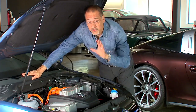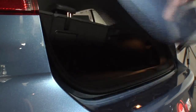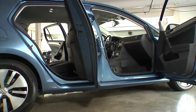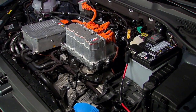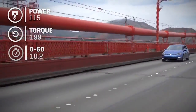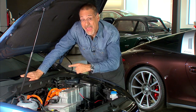Under the hood of our E-Golf is strictly an electric motor — not a range extender, not a hybrid, not a plug-in — a straight EV with no transmission, just a single-speed reduction gear. The battery story is central: a 24 kilowatt-hour lithium-ion pack using the latest technology. It doesn't intrude in the back or create a big lump in the cargo bay. The battery largely lives under the rear seats and through the center tunnel. They also did not need a separate elaborate battery cooling system — the Panasonic batteries cool themselves in everyday operation. Numbers: 115 horsepower, which doesn't impress anybody, but 199 foot-pounds of torque. Zero to 60 for this 3,400-pound car is about 10.2 seconds. This electric version weighs approaching 500 pounds more than a Golf 1.8 TSI, with 700 pounds of battery being a big part of that.